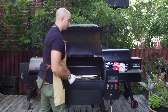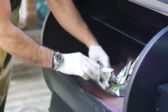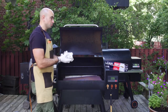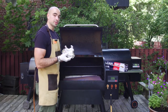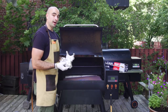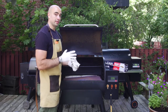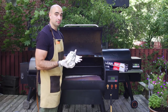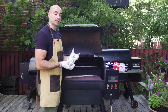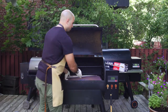The first thing you're going to do is, if you have been cooking on an aluminum foil lined drip tray, you're just going to take that off. This makes cleaning your grill so easy and it's super important because if you don't line your drip pan with foil or some kind of liner, all of the grease is going to get caked on to this grease pan. And every time you cook at a high temperature, you're going to have a grease fire hazard and also a lot of smoke buildup. So I highly recommend always lining your drip pan with foil. Change it whenever it gets dirty — sometimes you're cooking something like a rack of ribs for six hours on a low heat and it's not going to render much fat, but if you're grilling steaks or burgers, that's rendering a lot of fat, so you're going to probably clean it at least after every use. This just goes in the trash or the recycling.